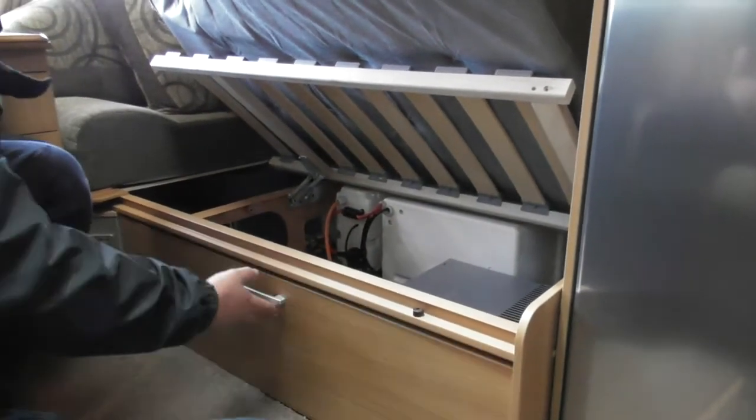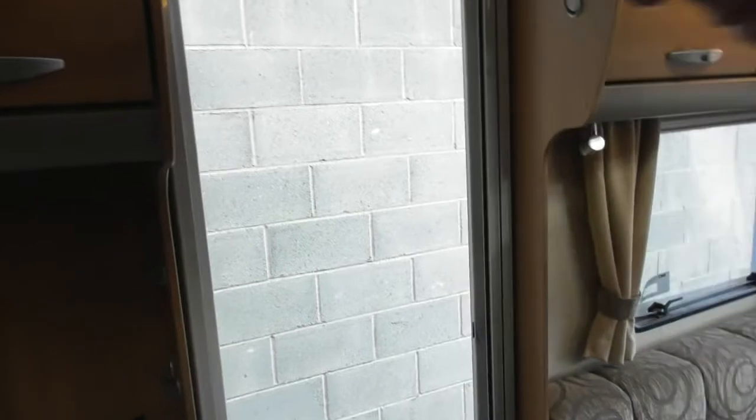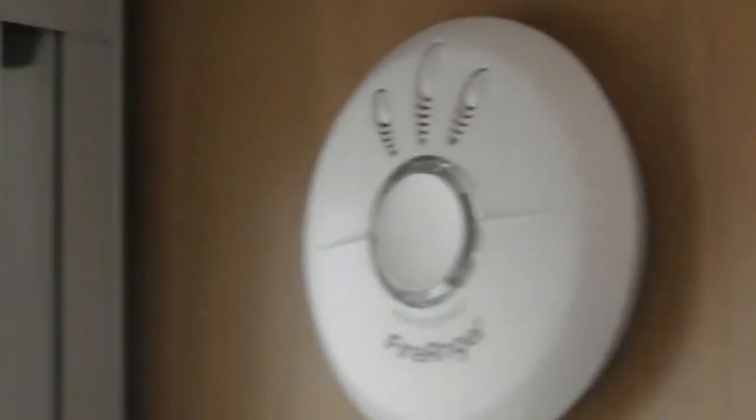Yeah. Perfect. So, I'll do the control panel above the doors now. Believe me, that's the most complicated things done now, so the rest of it's quite straightforward for you. So, control panel above the door, so simple. Power off. But do you notice these two lights are still on? Yes. These are because they're directly wired into the 240, your main supply. So imagine if I pull that blue cable out, these will go off. But other than that, when you're plugged into mains electric, these are always live.